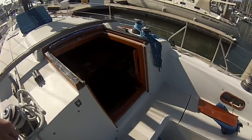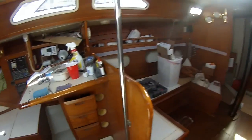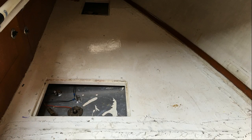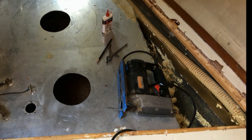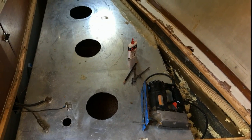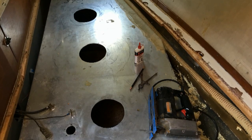What's inside a 50-gallon diesel fuel tank manufactured in 1984? Only one way to find out. The lid had been fiberglassed in, as you can see, and it took a circular saw to carve it off and open up the 1/8-inch aluminum tank. I cut three 6-inch inspection port holes in the top using my trusty jigsaw.